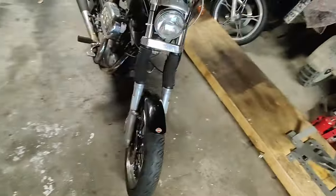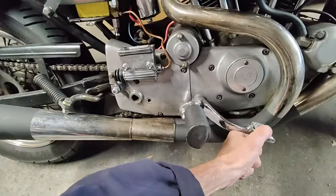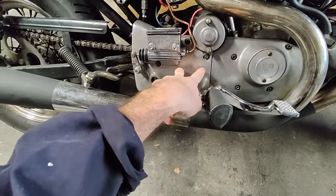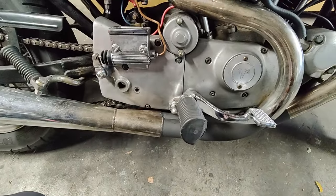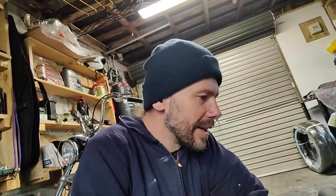Hello, we are back with my iron. I have a list of things to fix. I'm going to do a check of the brakes tomorrow. At the moment the lever works but it's a bit sloppy, and I'm wondering if I can shorten the bar. There's an adjustment at the end but it's such a pain to get in there, so I've been stalling. I'm going to take apart the brake mechanism and see if I can make it shorter so the brake lever sits a bit higher. That's the number one priority because we're going for a brake test tomorrow morning.